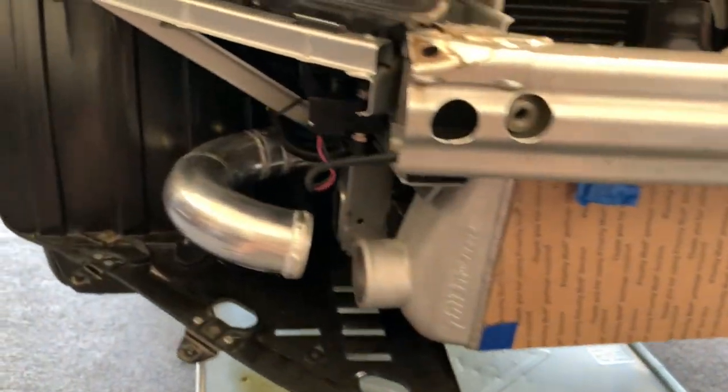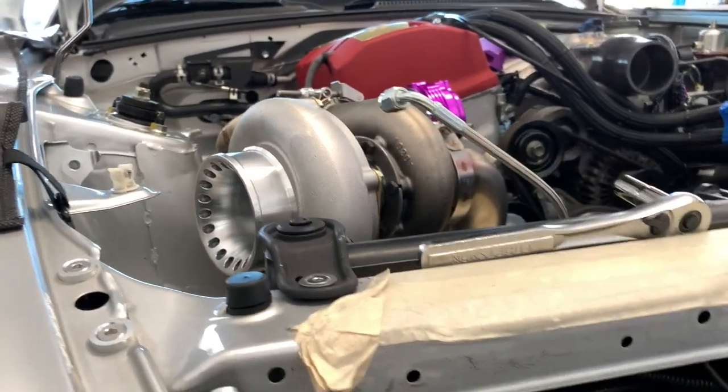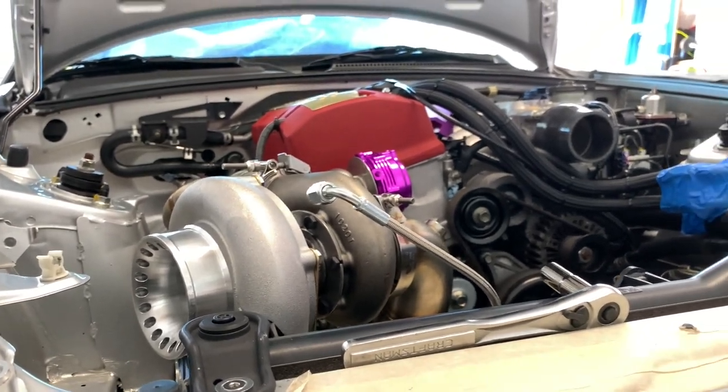Other than that, today I'm just going to finish mocking up the exhaust — running open three-inch — get this thing building oil pressure, and test the fuel system. Now for injectors: I was going to run ID 2000s but they don't make them anymore, so I'm running the Bosch 2000 or 2200cc injectors with twin Walbro 255 fuel pumps. It works, I don't over-complicate it, and it's good for the power level I'm targeting — no more than 700 horsepower.